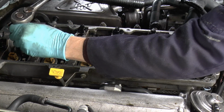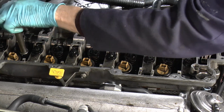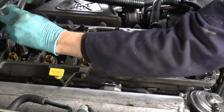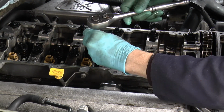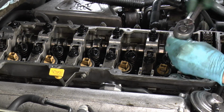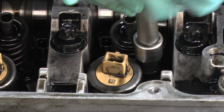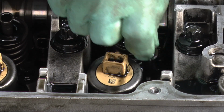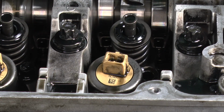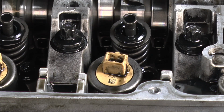Slotting all the clamp bolts off, but I'm going to take the injectors out one at a time so there's no danger of getting mixed up. And we'll start with this one. Right, these should be renewed when you put the lot back. Well, I'm afraid this is all I've got, so it's going back in.